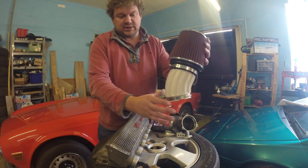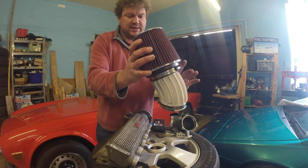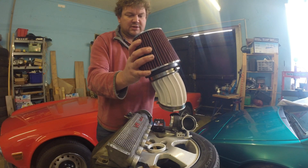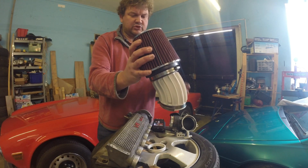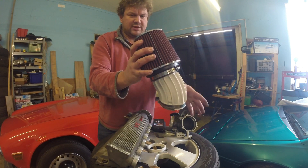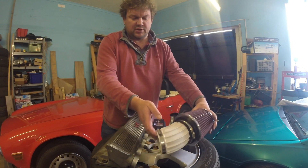Because I designed it in OnShape, you've got a few perimeters which you can extrude, and then this shape is — if I turn it this way — swept along a path like this and then swept along another path like that. By adjusting the center point of those two arcs and the length, I can pretty much make any length or any shape of curve that I want.